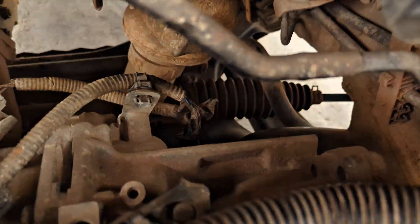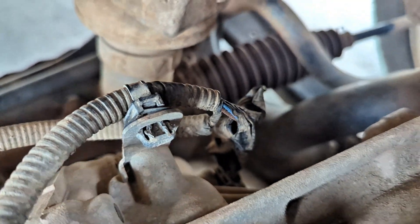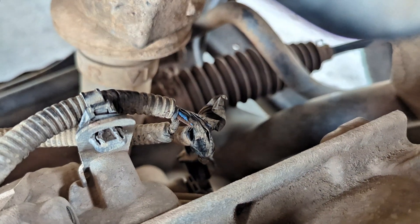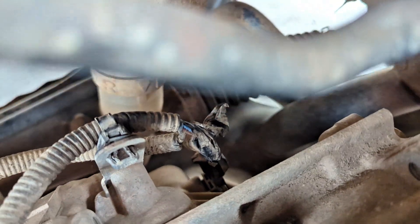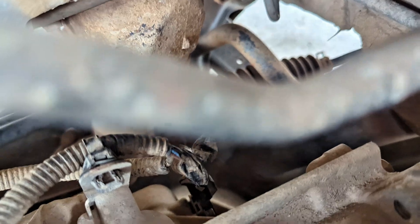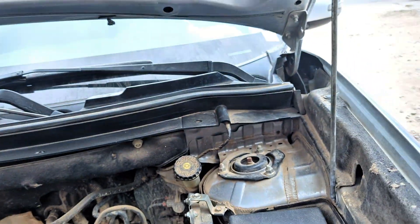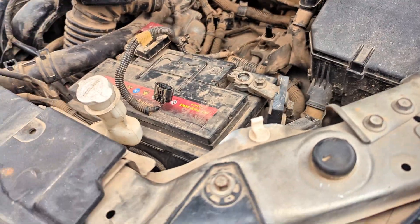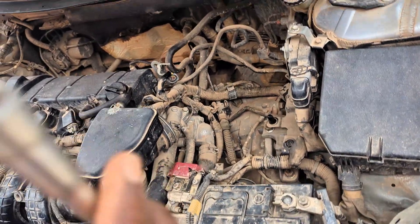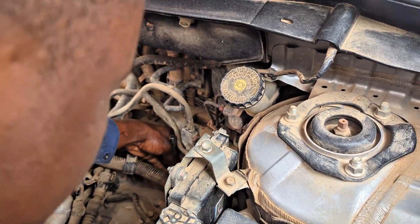The sensor cable runs down near the steering shaft. My camera isn't focusing well enough for you to see, but it's way down there. Once you take the airbox out and look down, you'll see it closer to the stabilizer bar. Grab a 10mm L-type wrench or a ratchet to loosen it — get the 10mm L down there to access the sensor.